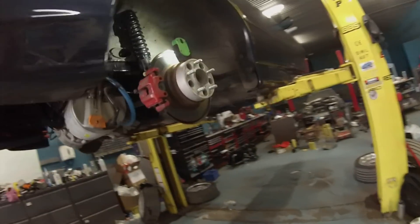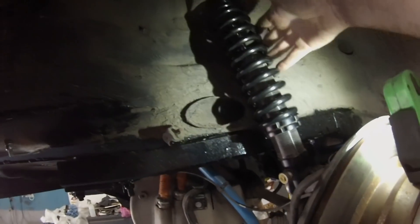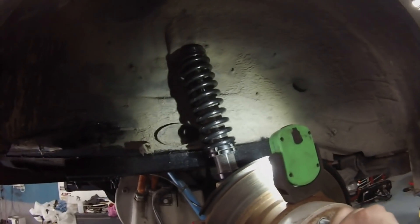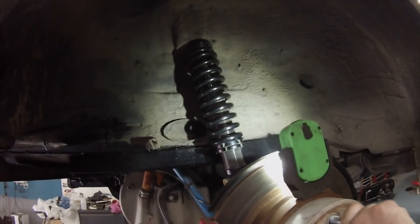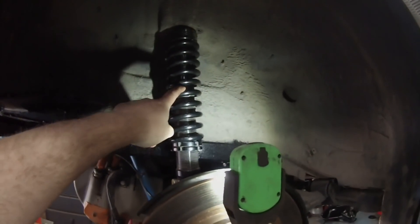Welcome back to Dave's workshop for the next panzer update. What we've primarily been doing is replacing springs on the back — we've got some nice new 600-pound 9-inch springs replacing the 500-pound 7-inch ones, which should give us significantly more travel and spring in our step.